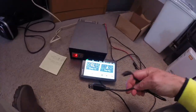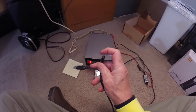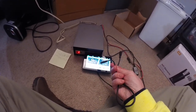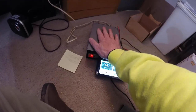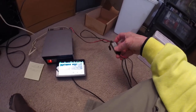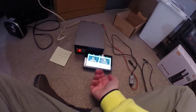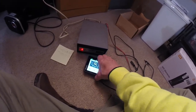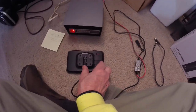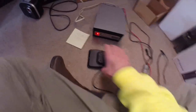So this is the typical cable they give you to charge from the back connector — that's just a USB micro. Your internal battery will not charge with this micro USB connector no matter what you do, whether the Zumo is on or off. The 12-volt cable and DC-to-DC converter actually brings 12 volts down to a USB 5.1 volts, so the Zumo is only getting five volts to the mount.